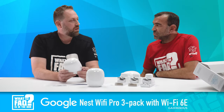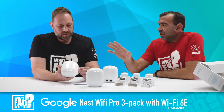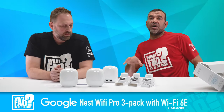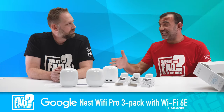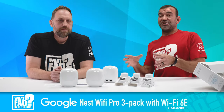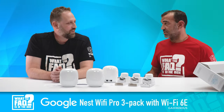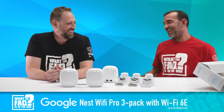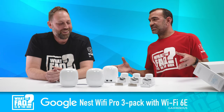In the box you've got a three-pack of Wi-Fi 6E routers — a step up from Wi-Fi 4 and Wi-Fi 5. Wi-Fi 6 gives you lower latency, so there's faster communication back and forth. The big technology behind that is OFDMA — orthogonal frequency division multiple access — which essentially means multiple devices can receive information simultaneously, speeding things up and lowering latency.